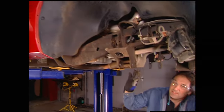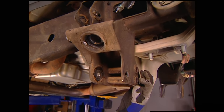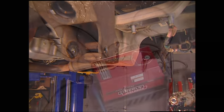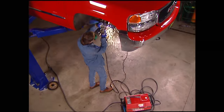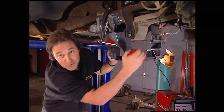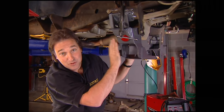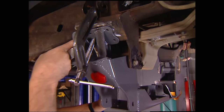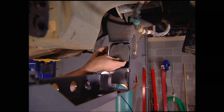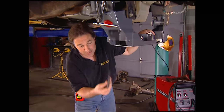On the passenger side, the modifications are pretty much the same — bump stop cup comes out, the alignment pins. But down here, all you have to take is a little bit of this corner for clearance, which is a whole lot different than all you had to cut out on the driver's side. Now we're ready for the new cross member. It slides right in here to these lower A-arm pockets and uses the stock hardware. It's very important that this is in perfect alignment, so do whatever grinding or drilling you have to to make it right.